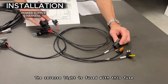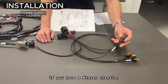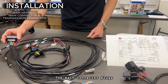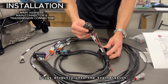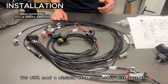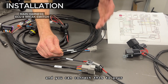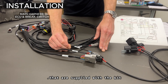The reverse light is fused with this fuse, and it can be connected directly to your chassis harness by the mating plug, or directly if you have a Nissan chassis. The ground connector needs to go to a clean place on the chassis — make sure it's a solid connection directly to steel. The main connector plugs directly to the controller itself, and the transmission connector plugs directly into the transmission. The minimum requirements for the controller to work will be found on the CAN4MAN web page. You will need at minimum a connection with your ECU and a brake switch. The car ECU CAN connection is marked on the wiring schematic, and you can connect this to your CAN high and CAN low on your ECU using flying leads and the mating connector supplied with the kit.